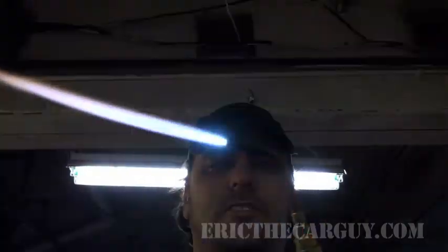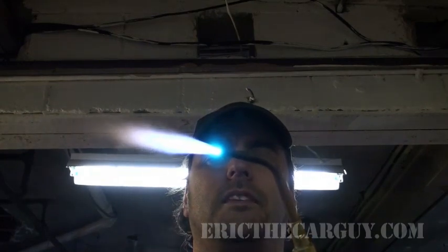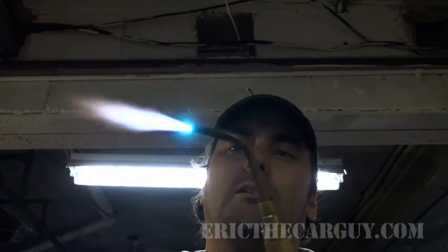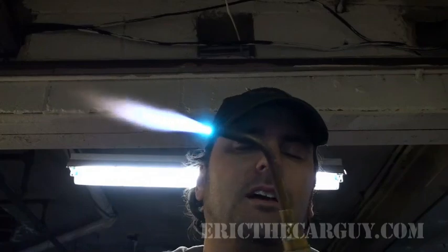After that, I add the oxygen slowly. A little more acetylene. This is about the flame that I like. It's nice and blue, which means it's nice and hot. But that's basically the flame that I'm looking for if I'm heating something up. Cutting is something...